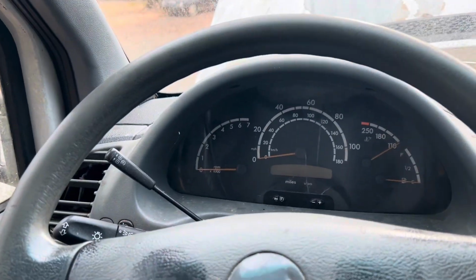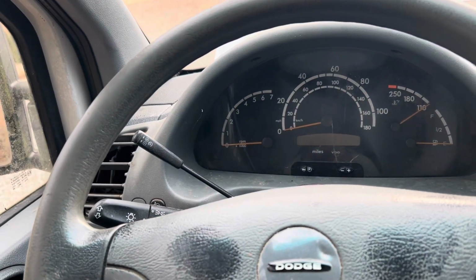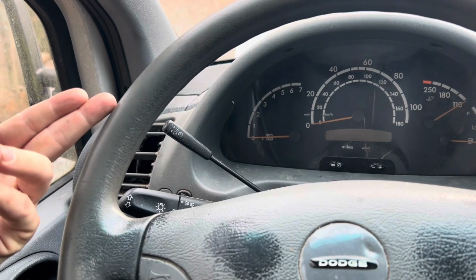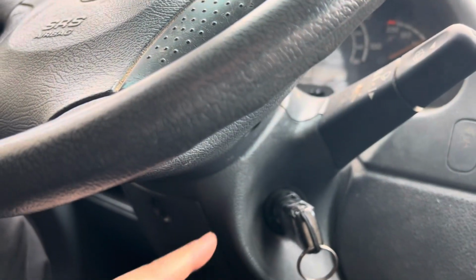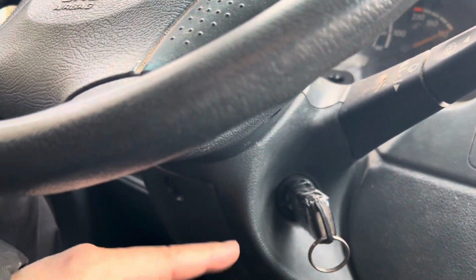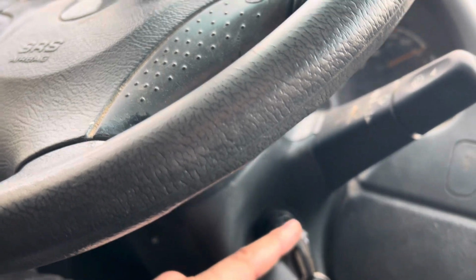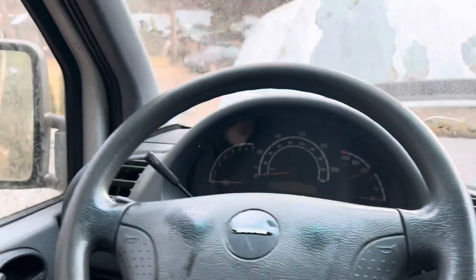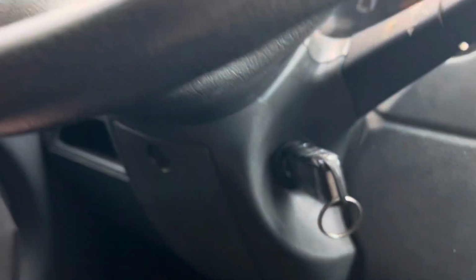And if you turn it all the way, the start error technically should disappear or not appear to begin with, because now the battery would be disconnected. Once you reconnect it, hopefully it cleared itself. And then when you turn the actual electronic ignition switch with the screwdriver, it will start. And that's how you know that your ignition switch is bad.